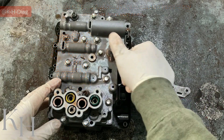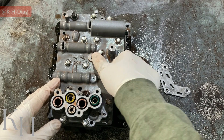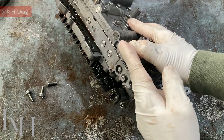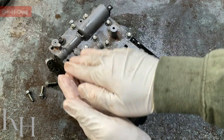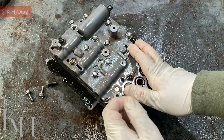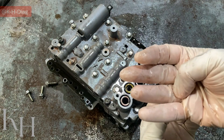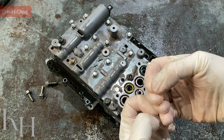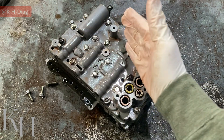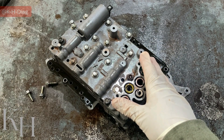There are oil passages here — this one goes to the UD brake and this one goes to the LR, or low and reverse brake. This valve body has three layers: the outer layer, middle, and inner one. If you remove all these bolts, you are dismantling the entire valve body, and there are many steel balls and springs inside. If you remove this and are not careful about the location of them, you're going to be in trouble. I'll share some information for those control valves just in case you've dismantled them and don't remember where to put the springs and valves.